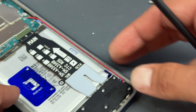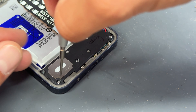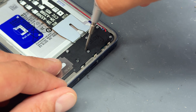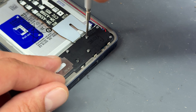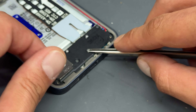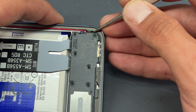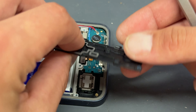We'll leave the motherboard in place while we disassemble the sub board. There are eight screws holding down the sub board — these are the same size as the ones removed from the top of the phone, so don't worry about mixing them up. Use the tweezers to ping out any that are stuck, and look for one of those little marks which is our prying point. Then go in and pry upwards with the tweezers to release the speaker cover.